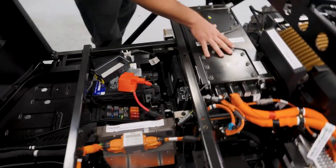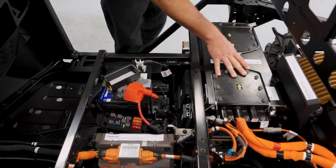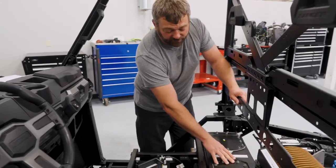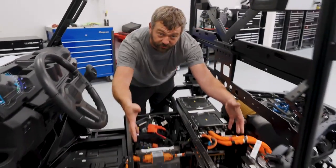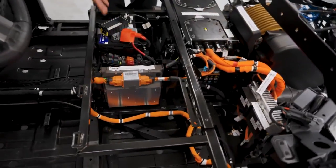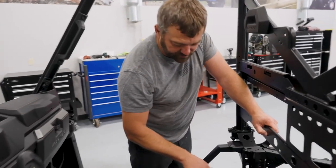This 100 volt battery pack here behind the passenger seat is kind of the heart of this Ranger XP Kinetic. This model particularly is a single battery style setup. If we had the dual battery packs, there'd be another one right here underneath the driver's seat — that open void of space is where the second battery goes on the 29.8 kilowatt hour version of this vehicle.